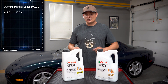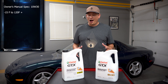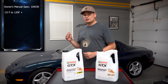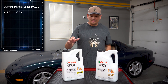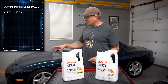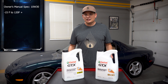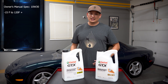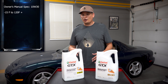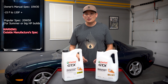It all depends on temperature based on what I read. Here in Colorado, in Grand Junction, summers can get really hot — we could see 100 degrees, dry and really hot. Add to that the temperatures a rotary produces, and a lot of people feel that a 10W30 isn't up to the job. Especially if you have modifications like a downpipe, a tune, a bigger turbo, exhaust, bigger injectors — the more power you're building, the more heat you're building. Tuners and enthusiasts say that 20W50 is a great oil for those hot conditions.